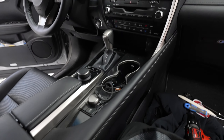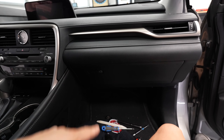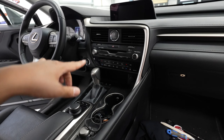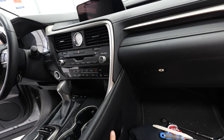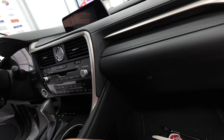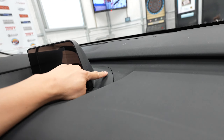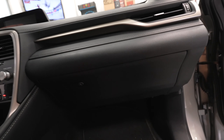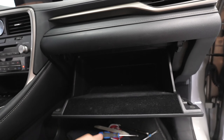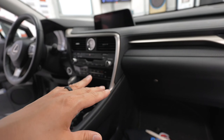Now that we're in the vehicle, let me explain what we're going to do. We are first going to get behind the radio, remove the top screen, and also drop the glove box. To remove the radio, we're going to remove these side panels, and then the panel that surrounds here — there are two 10-millimeter bolts holding it, one here and one on the left. To remove the top screen, we remove this front panel and the panel behind it — there are three 10-millimeter bolts. For the glove box, there are Phillips screws on the bottom and 10-millimeter bolts, which will drop it. We'll remove all those parts before connecting our interface.